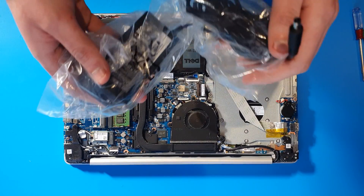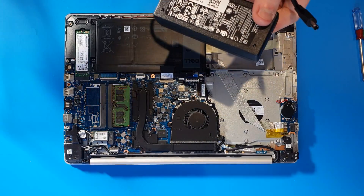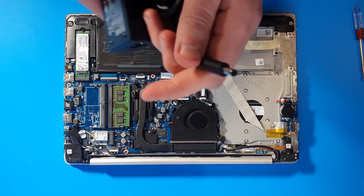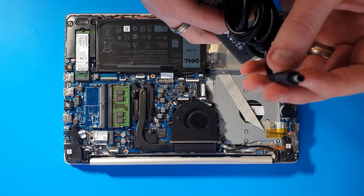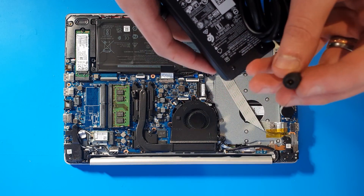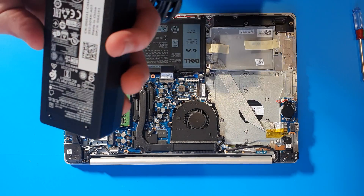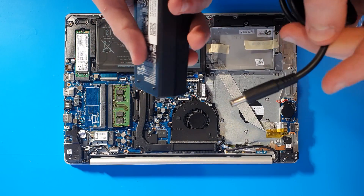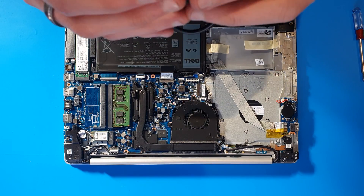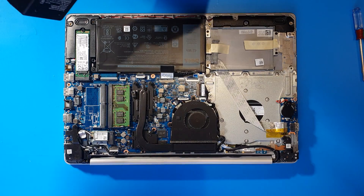You should visually inspect your adapter. Here's a new one — this is part number MGJN9, also on our website. It's a 65 watt adapter. What normally gets damaged is the center pin just in here. Check the cable for kinks — they normally happen around the ends. Make sure it's plugged in fully, and you could also check the fuse in the plug if it's not a molded plug.